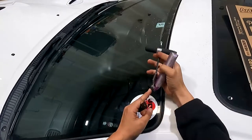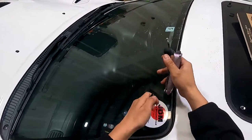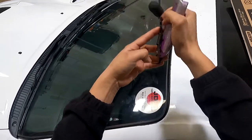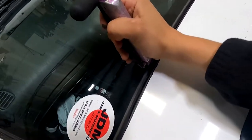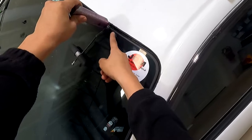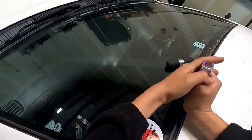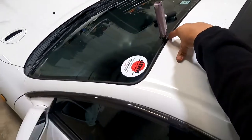Now this side is telling you it has to be toward the vehicle because there's clearance, so you don't have to worry about it. You want this portion — or the cable — toward the windshield. You're going to lock it in, line up the first ball, and give yourself a good little bit of height. The most important part: you want to get right in between that glass. You can use the interior body here to help push it underneath the glass, since this is not an exposed area — it's part of the pinch weld.